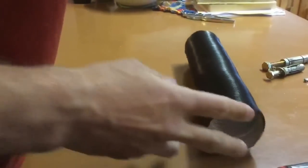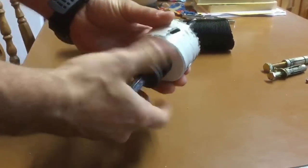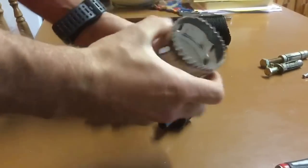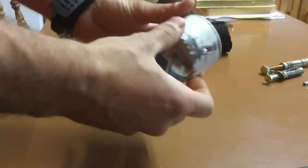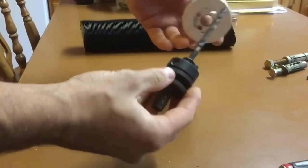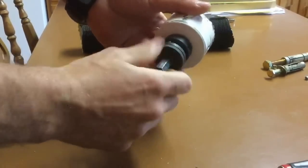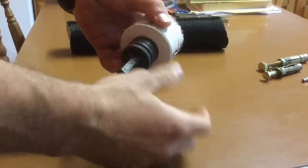To route this pipework, all I'm using is a 64mm hole saw. I find this is the perfect size. These are really cheap — you'll get them from Toolstation for not very much, and if you're only using it for cutting through thin pieces of wood, you don't exactly need a really good one.